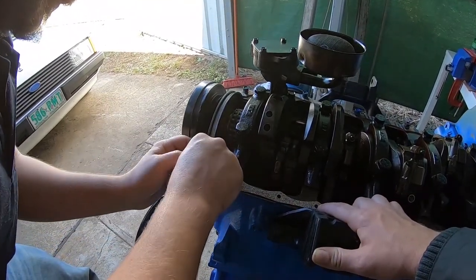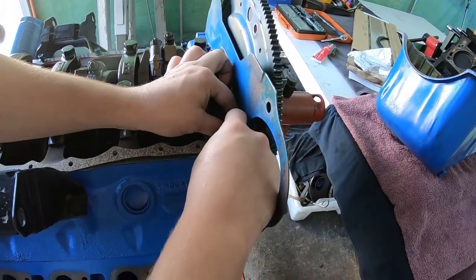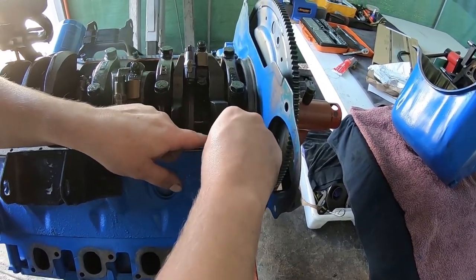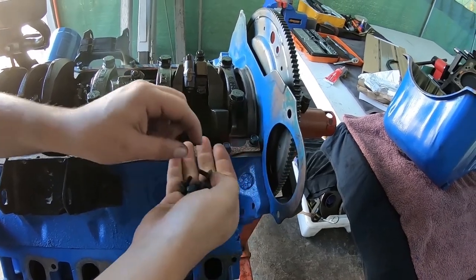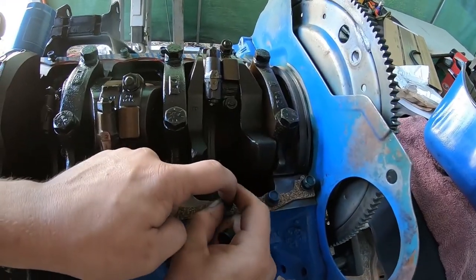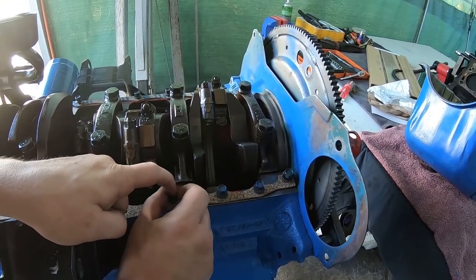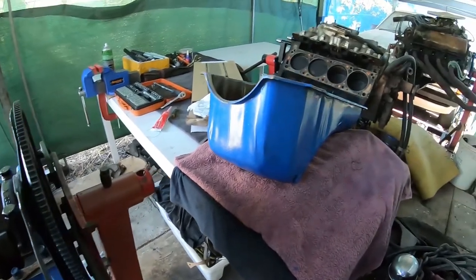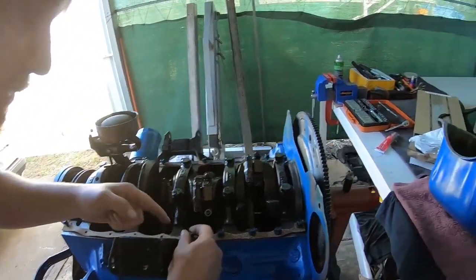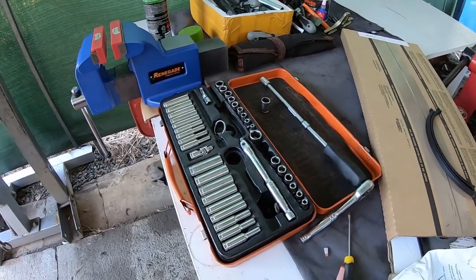We'll put a big bolt here, a bolt in the back. There's a fair bit of silicone there that's probably going to get in the way later. My tip if you're doing this under the car is to use a quarter-inch socket set with two long extensions that are longer than that deep part of the pan — you'll have the most clearance to get in between the engine mount and things. All you need is a quarter inch.